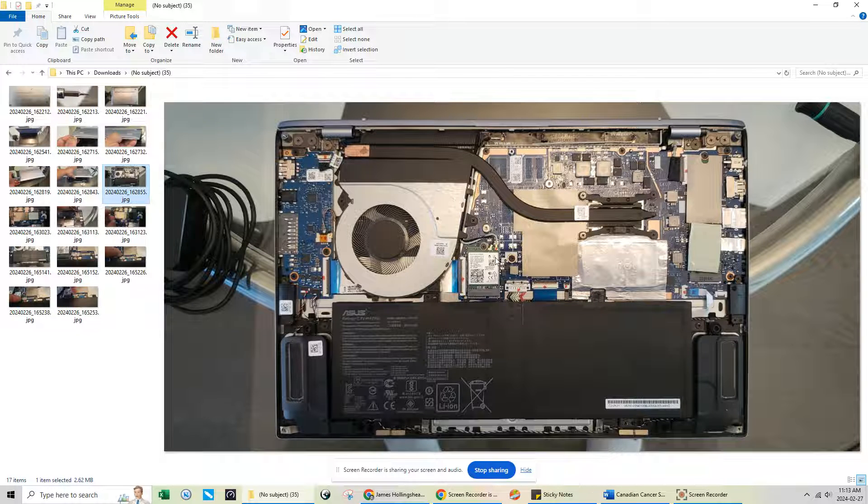For the Wi-Fi card, if you do need to remove it, use a pick tool or your fingernail to pop it, because a lot of people have a hard time putting those two caps back on. Remember the orientation: white cable on the right, black on the left. Use a flat plastic tool when putting the caps back on and gently push them down - don't force it or you'll collapse the round connector head underneath. Wi-Fi card failure is very rare; in 24 years I don't often see it. These days people just buy a USB wireless adapter instead.